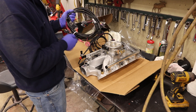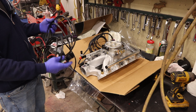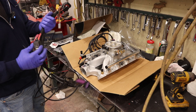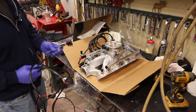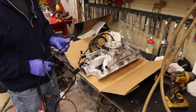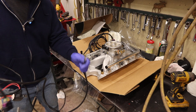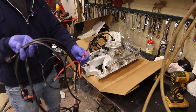I'm orienting myself to this kit and it's pretty straightforward. Let's call this the computer part of the harness — this plugs into the computer. There's a little pigtail here if you want to do a CAN bus interface. This is just a relay — I need to find a place to mount it. That's a fuse. This goes to the injector harness. This says coils IAC — I'll look that up to verify. This goes to your O2 sensor. On this harness: power, ground, and the wire that's hot in crank and run.